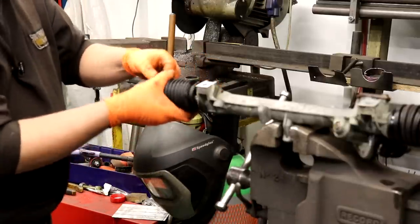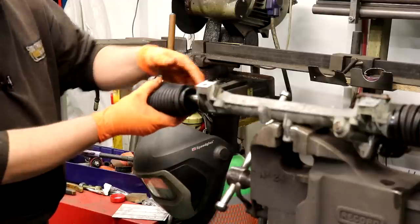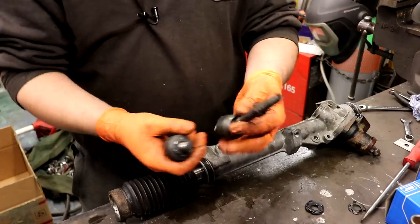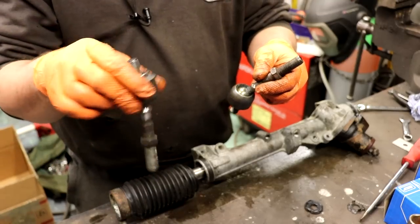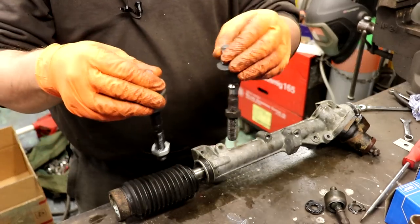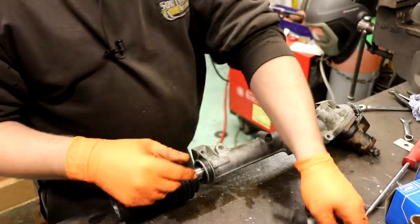So that comes off from there. What people have to do on the car is stretch this over the top of all that, sometimes while the track rod end is still on there. As you can imagine, that is not how you go about having a fun time. So I've got the joints off — they are shot. That one, and that one — that is absolutely knackered. Wiggle wiggle, stir stir. Yeah, these are shagged.